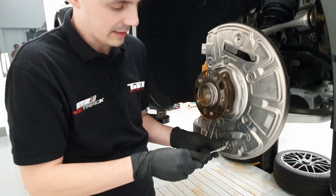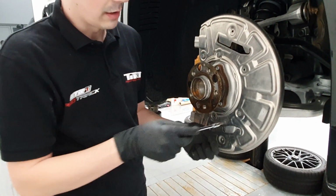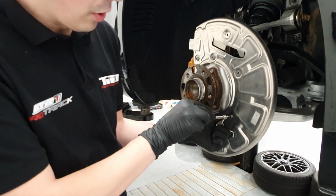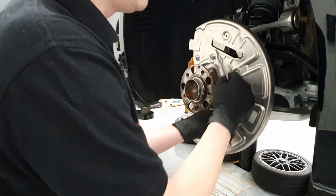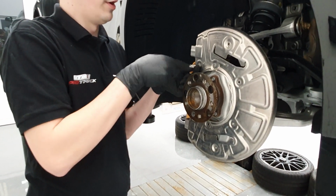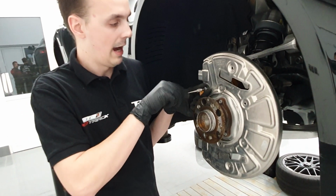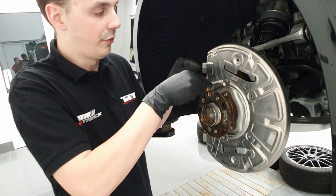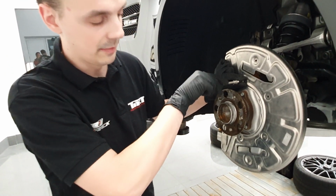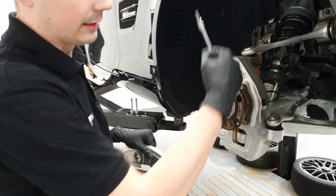Now there have been questions if this part is modified or whatnot to install the Tikt duct. No, it's not. It's completely removed. Some aftermarket solutions, GTR Pro for instance, have the brake heat shield being cut in order to allow more of the flow to the inlet of the rotor. But as I have previously explained, that itself is not sufficient, because the air will flow through the path of least resistance, and that is actually back into the wheel housing and again into the center of the rotor. So instead of ventilating the disc, it's being recirculated through it.